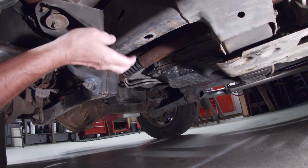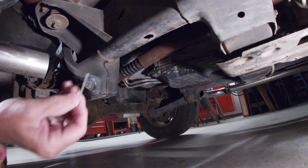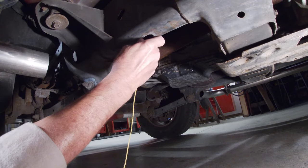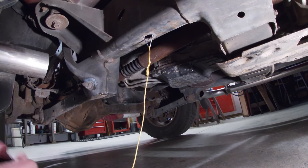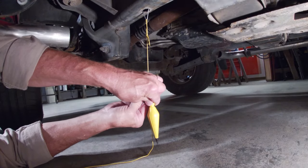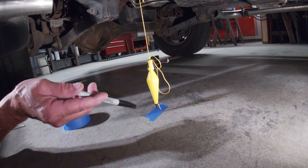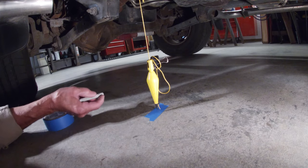To get started, I'm on the left frame rail — this is the left front torque box. We're going to measure off this hole right here. That's where these little pieces of wire come in. I loop that through here and squeeze it just enough to get it in there, and that self-centers it. With the plumb bob, that's where the paper clip comes in — this will set our height so we can adjust it. I'm going to put a piece of tape underneath and put an X under this plumb bob. You could just put your marks on the floor, but if you want to change something and you've got extra marks on the floor, it might confuse you during your final measurement. So we can just pull up the tape if we want to.